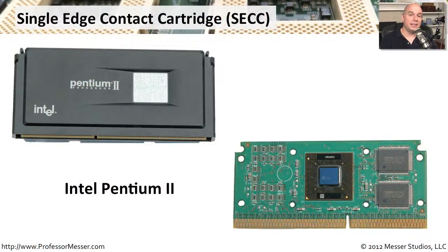Fortunately, Intel saw that using this type of CPU package was not easy to work with, so they came up with another type called the single edge contact cartridge, or the SECC. We started seeing this with the Intel Pentium 2 — it came in a big plastic package with a slot at the bottom used to plug into the motherboard. Inside is the CPU itself with some additional cache memory on the outside, and at the bottom you can see that single slot. We could simply push this cartridge right onto the motherboard, and if we needed to uninstall, we simply pulled it right out.